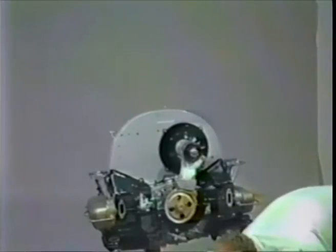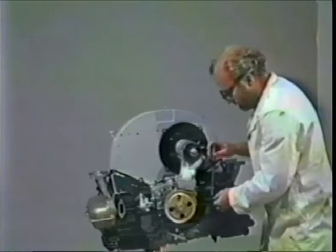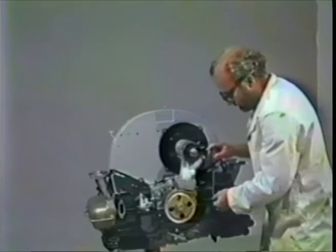Now at this point, it also helps to put rags or paper towels, whatever, into any open hole that leads down inside the engine, like the intake manifolds or here, the oil filler can. Prevent any wayward screw or nut, bolt, washer, whatever, from falling down inside. We're not doing that right now because we're, of course, incredibly careful, and this never happens to us. Aha.